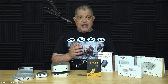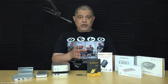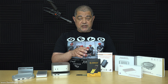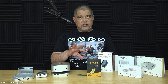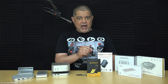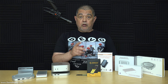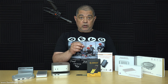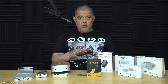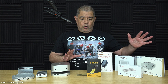That issue happens with every single SSD out there. However, with an expensive SSD like the Western Digital SN850X or the Samsung 990 Pro, when they run out of SLC cache they'll be writing to their long-term NAND at somewhere in the region of 1.5 gigabytes per second — and that is what you're paying for with a more expensive SSD. Although there are also some pricey 4TB SSDs that plummet really low once they run out of SLC cache too.